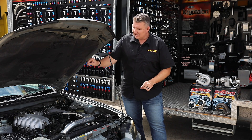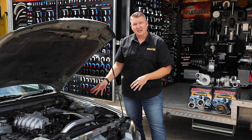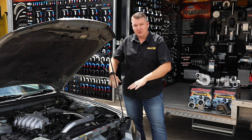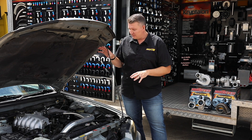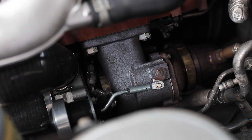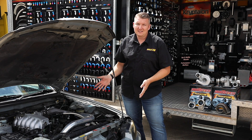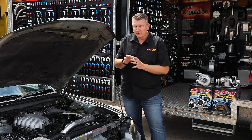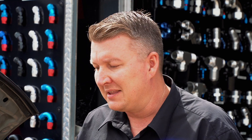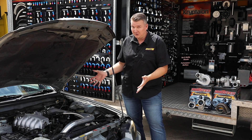This car had a front-mount intercooler and a catback exhaust — that's it. Everything else is completely standard: standard valve springs, standard injectors, standard manifold, just the intercooler piping and the new turbocharger installed. Not even a flash tune, no aftermarket computer, nothing at all. The car runs our 5455 at 10 PSI on 98 octane and now makes 240 horsepower to the rear tires, coming on at around 3500 RPM.